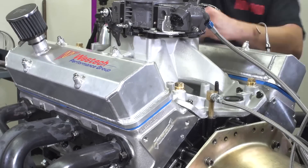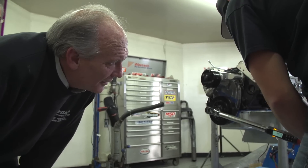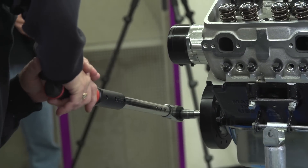The motor is back together and reassembled on the dyno. These are the old 5/64 rings and pistons — they're done, they served their purpose, they made a number. We've got the new 1.2mm ring pack in. We're going to run that in the next couple of minutes and see what kind of horsepower we pick up. We saw some cool stuff even in just the preliminary checks, like the breakaway torque. We put a torque wrench on the engine with no valve train after the first run with the thick piston rings and saw an average of 35 foot-pounds to spin the motor over. Then with the 1.2mm rings, we saw about 14 foot-pounds to turn the motor over by hand.